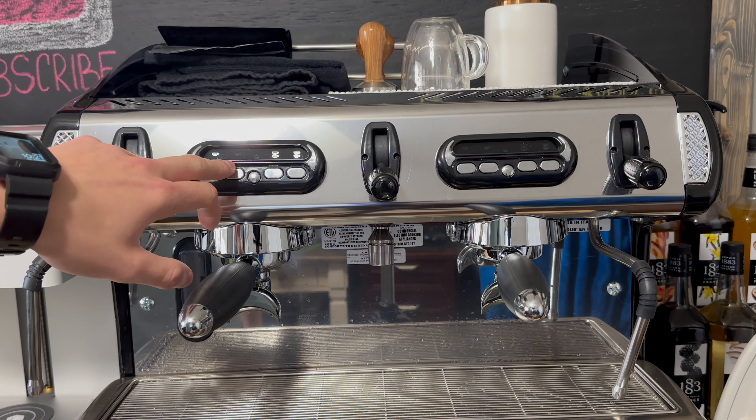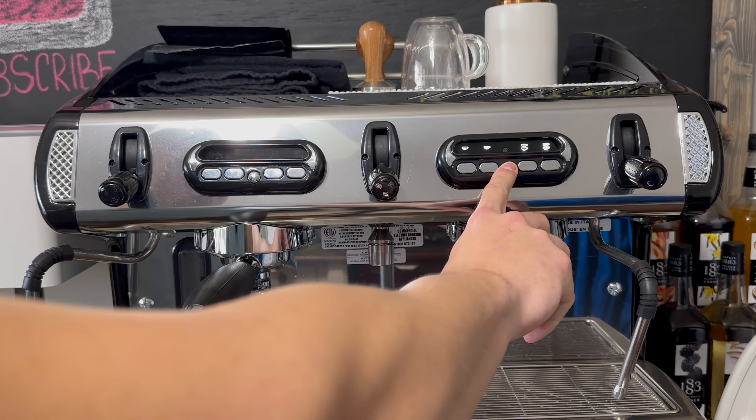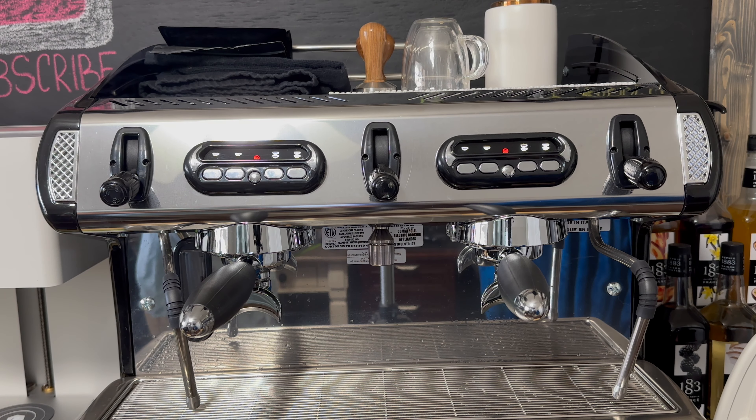For example, I'll go ahead and pull that same shot again — you'll notice it gives about the same exact output. Done. Now that is preset so every time you press that button, you get almost the exact same volume from that shot and group head. If you go over to the other side, if you adjust a button on that one, it will change it on this side as well. So note: you can't do separate doses for each individual group head, but you can have four different presets, which is nice for a capable machine like the La Spaziale S9 Compact two-group.